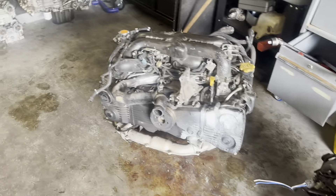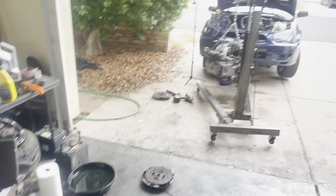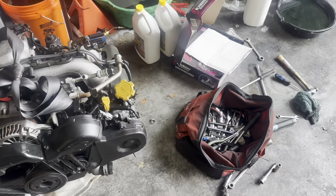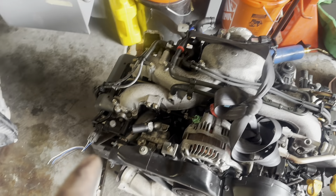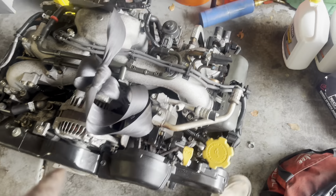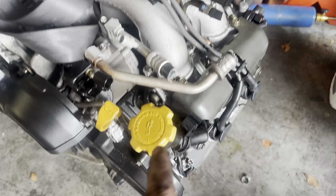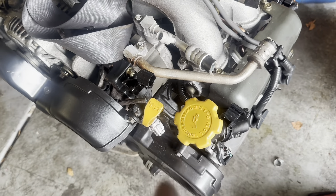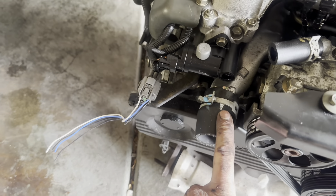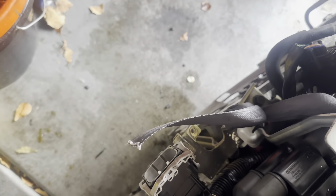There's the Impreza block — I'm also going to get a valve cover done on it, you can see it's leaking pretty good down there. And then this is the new Impreza motor, the old one's on the engine lift still. This engine — I'm going to remove everything that we don't need. The power steering pump I left on that car so I don't lose power steering fluid, so I'm going to pull the power steering pump off this. Keep the alternator off, hopefully it's just a good alternator. Both of these lines need to be taken off, this flex plate back here needs to be taken off, fuel lines, AC lines. I'm not sure why they cut them. Take the headers off because the headers are currently sitting on the bottom of the car.